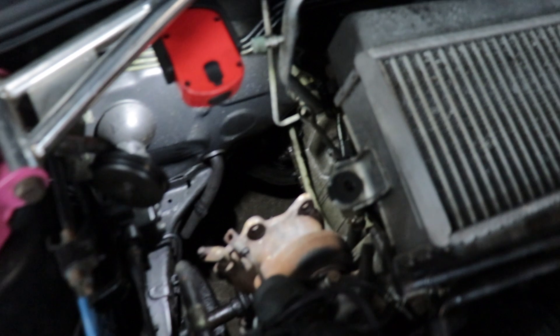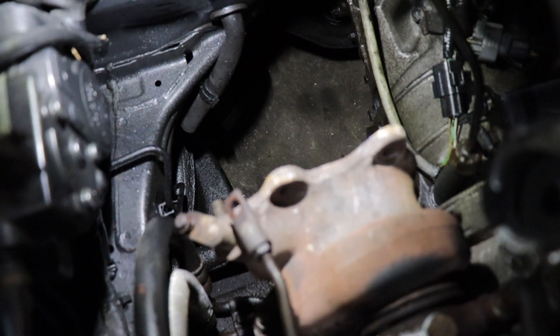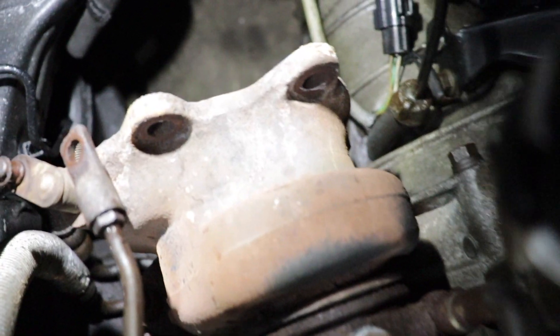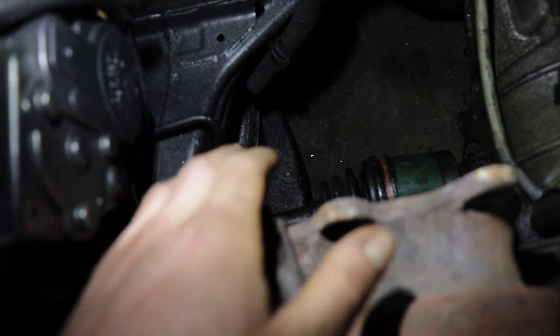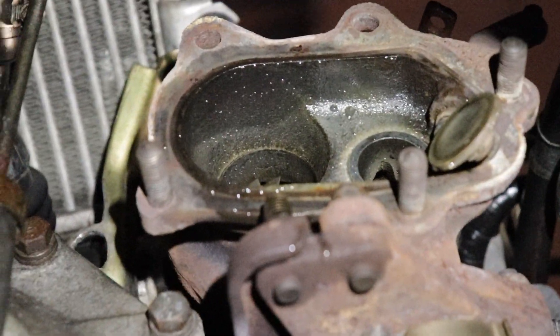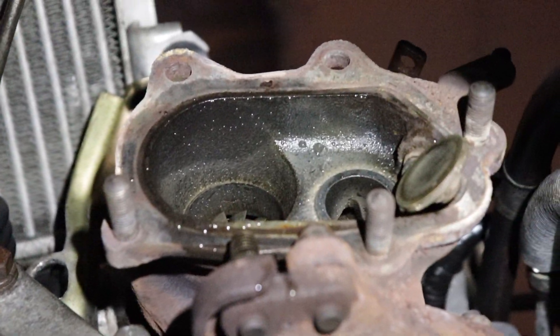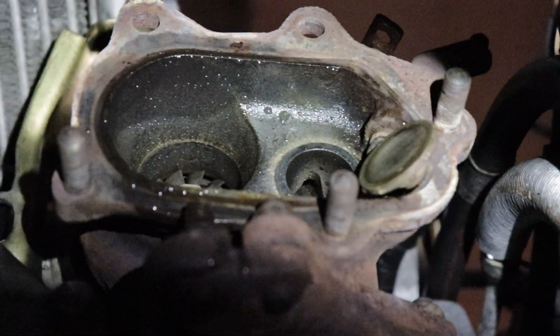It's definitely something internal one way or another. I already got the exhaust off because I was looking at the backside of the turbo to see if we had any oil visually right behind the exhaust housing, but I don't see anything there. So what I'm gonna do is stick a bore scope down in the bypass. There's the back of the turbo - it is a little wet just because of condensation, it's really humid out today, so I expect that from the heat difference.